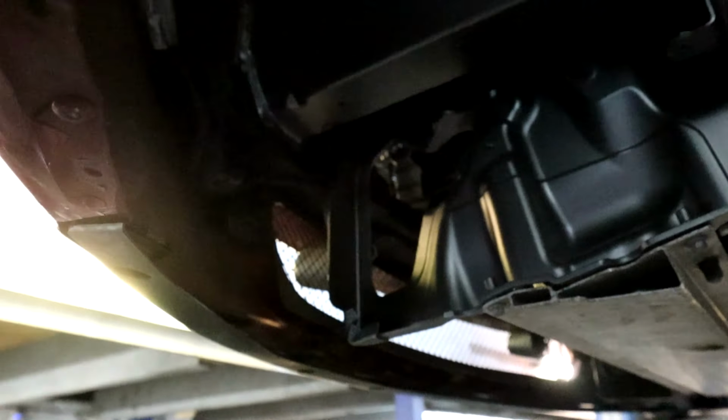Basically, that stud that's in the middle there, you can see some little smoulder where I've been welding on it. There's a stud in there, and you can see the access here now to get anything in there. I mean, it's reasonable, it could be a lot worse, but that is a mount for the airbox, and to progress any further before the wheel arch liners go in, all that sort of stuff, it needs to come out. So that's today's task. I can crack on with the other side and get the airbox into the other side, but until that's out, it can't go fully together.